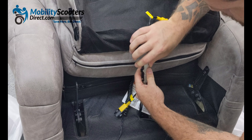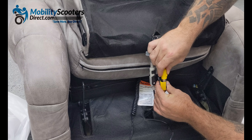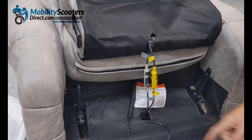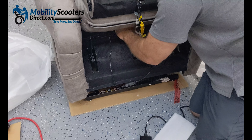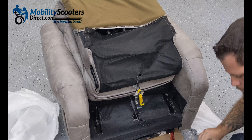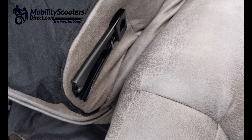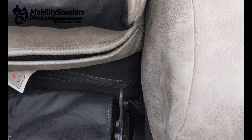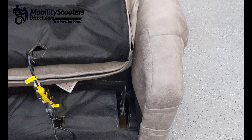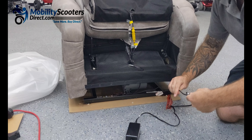The connectors will not fit unless you have them lined up perfectly with the pins and the holes on the respective two ends. There is a little plastic black clip that secures them together when you're done connecting them. The point of putting the wire through the middle is so that the remote control wire can go through freely without getting pinched in any of the hardware components that actually mechanically move the chair forward and back and up and down. You'll find two sleeves, one on the right and the left side of the top part of the chair, with corresponding seat posts that slide into those metal sleeves. First you're going to want to untie the wire that is used to plug the unit into the transformer box that actually delivers power to the unit and that has the battery backup.